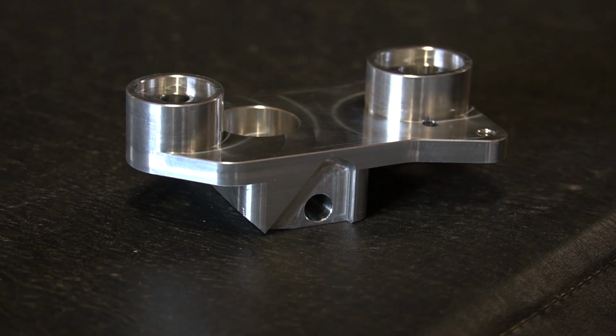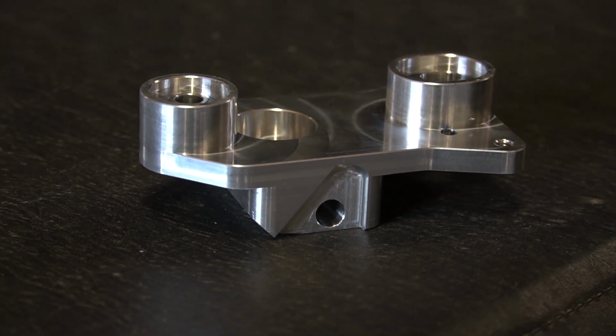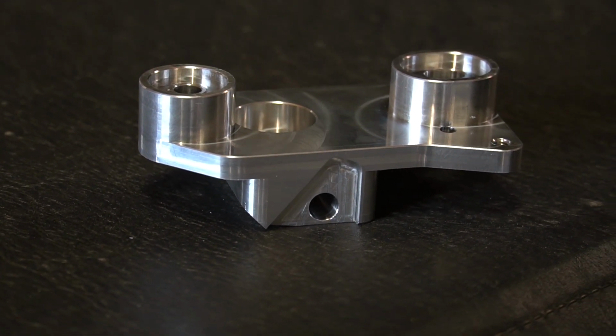You have all your adjustment should you want to do anything with that, adding or subtracting or cross castering. If you're trying to get rid of a tire pull or something without a stabilizer, et cetera, you've got your full range to do with what you'd like because of those radius arm drop brackets. No problem, quick trip to the machine shop. We made something for this customer to keep its location, but allow the fitment that was impeded by the factory bracket. Other than that, everything bolted on.